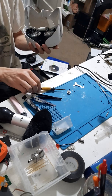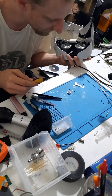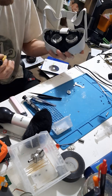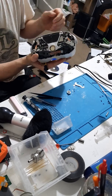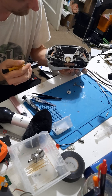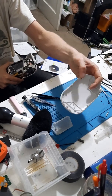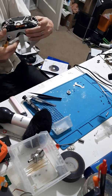Once you get it that far, there is a total of four screws in there. There's one in that corner, one in that corner, one in that corner, one in that corner. Then you can flip it over. Once you get those out, you can go along and pop all the latches, and then this piece will pull out. See all the little latches along the edge there? You can pop that off, and then you'll have access to the cameras.